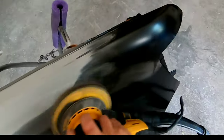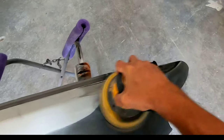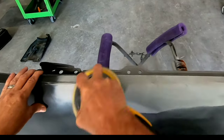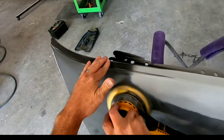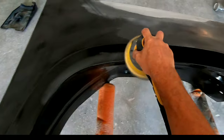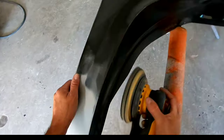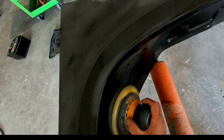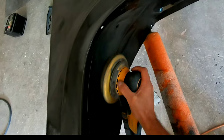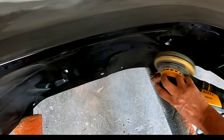When DA-ing this fender, keep the sander as flat as possible — don't sand on the hard edges, roll around them. I recommend an interface pad, which is a velcro soft pad that goes on the DA to cushion it and keep you from grinding hard on those edges. Some areas you'll have to hand sand using a 1500 grit scotch-brite, so make sure you have one available. We're also going to use it on the backside to get those hard-to-reach areas sanded properly.